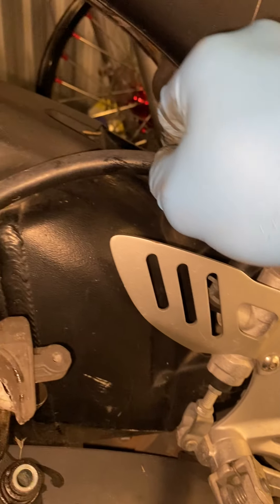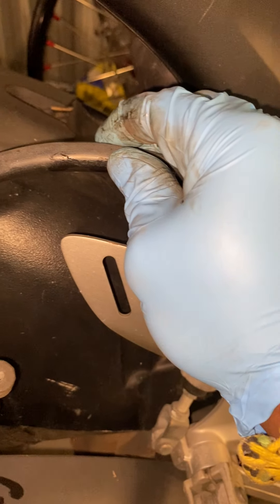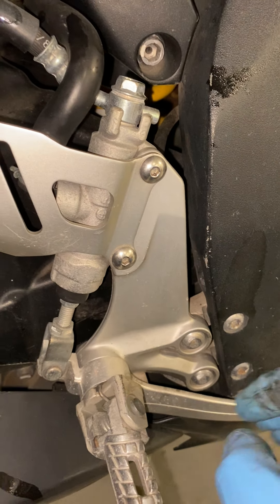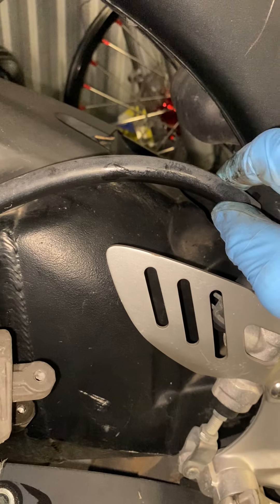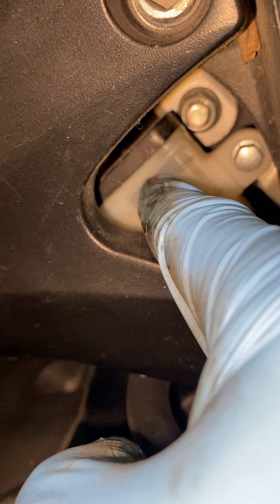You can also check your brake lines — these are old and I'll have to replace them because they're probably going to expand. How you check them: with the brake system completely together, put your finger over the line, pump, and pay attention to how much the line is expanding. If you have excessive expansion, you definitely have to change that line. The force you apply here sends through the fluid to your slave, and if the line is expanding you're losing energy — your brakes will feel spongy and you won't get the response you need.